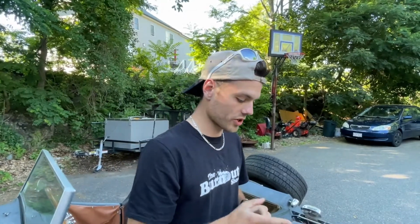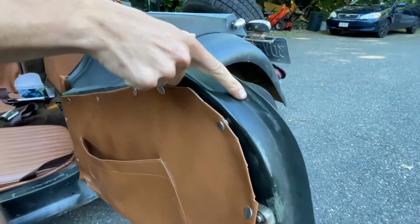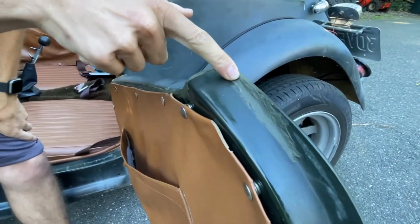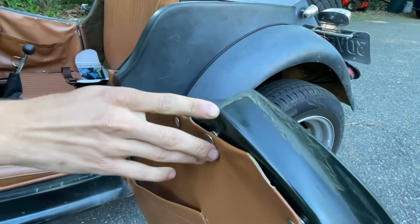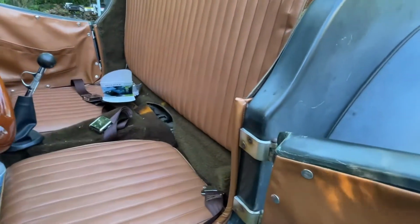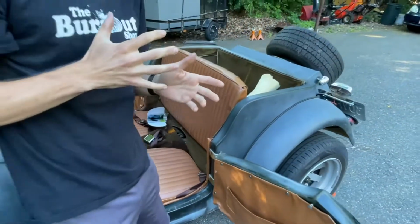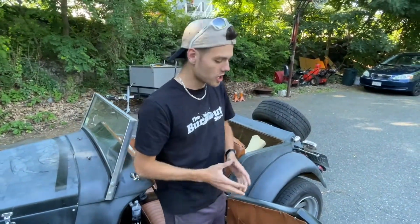And so what you have to do is put fiberglass Bondo along the seams. And fiberglass Bondo is much different than metal Bondo. That's what you can see this off-green color from the door is. And it essentially runs all the way down the door along the seam, because that was all cracking whenever I drive the MG. And so slowly, I have to add more and more Bondo just to make sure the door doesn't split apart.